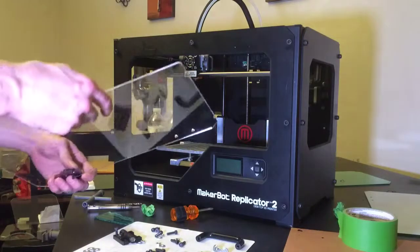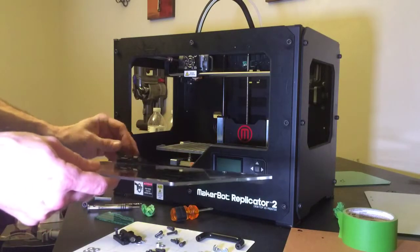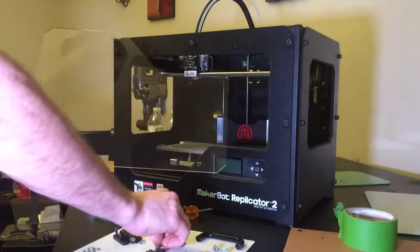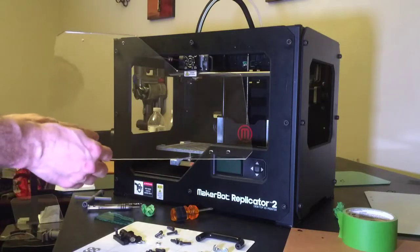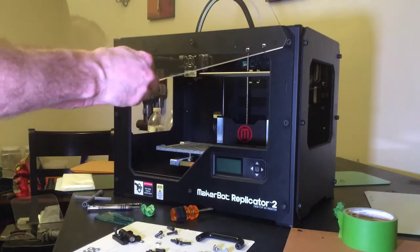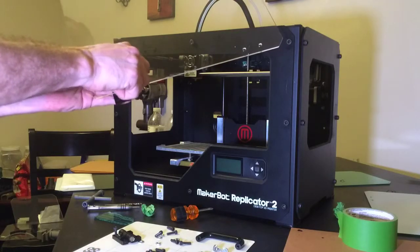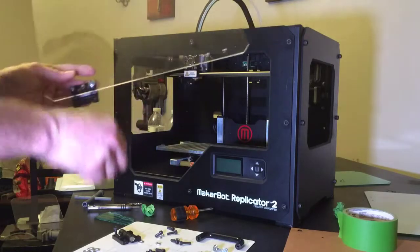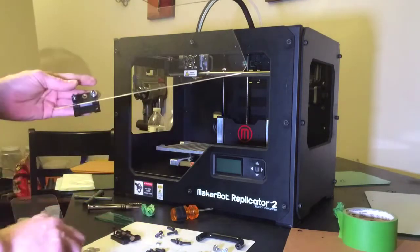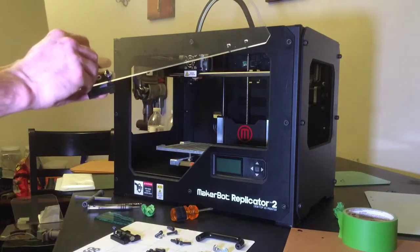That Phillips head, as I might have mentioned earlier, is a tensioner to tension how loose the bracket is to hold your door in place when you open and shut it. So we're going to hand tighten these with the washer in the back, and a bolt. And again, we don't want to tighten them too tight, just hand tighten. We want to give it a little bit of play because we're going to use that play to adjust the door before tightening it all the way.